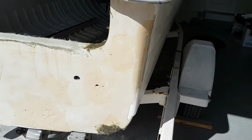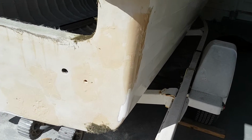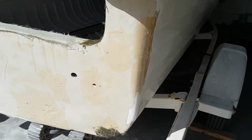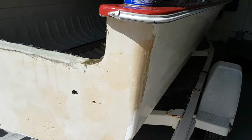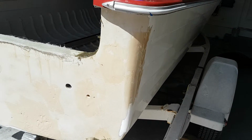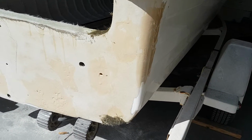and then you take a grinder or a sander to it. I'm going to use my orbital sander again, and you smooth it out and you start shaping it. And then any little divots and stuff that isn't exactly perfect, you throw some fairing compound on it and call it a day. So this should take care of the structure on the bottom. It's wrapped around, everything's fiber reinforced. That should take care of the problem on the bottom of the boat.